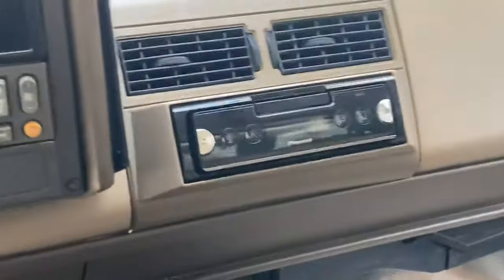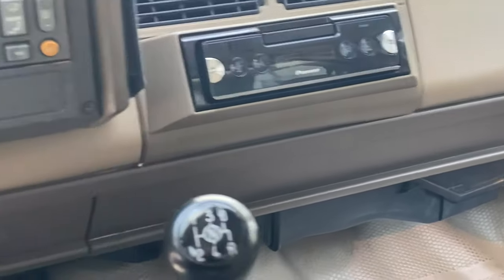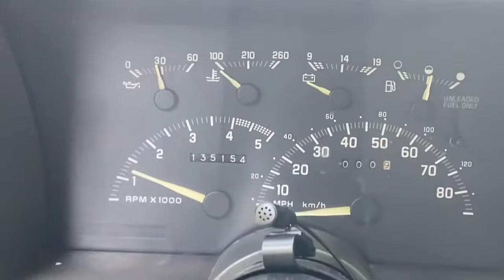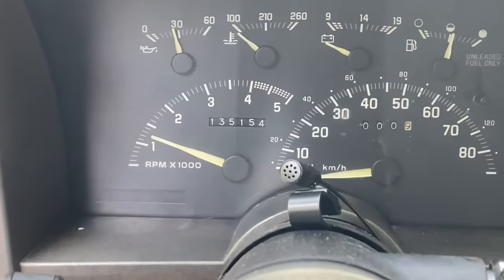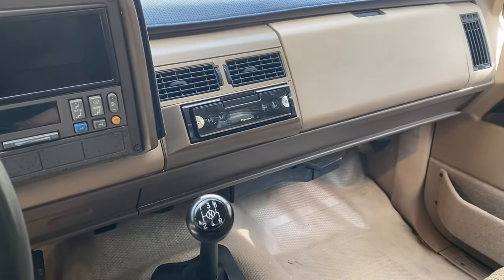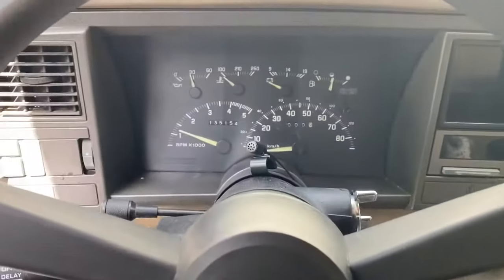The clicking you're hearing is coming from the blend door actuator for the heat and air conditioning. It's the typical issue with this truck — just that actuator slamming the door trying to open. It stops after about 30 seconds. To replace it you have to get under the dash, and I just have not had the time to do that yet. Soon enough that annoyance will be gone.